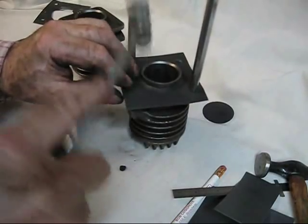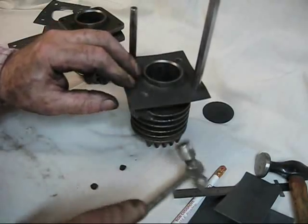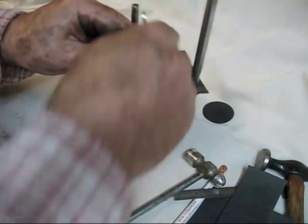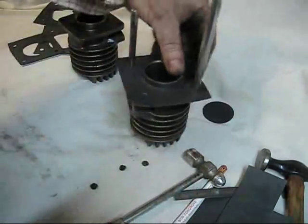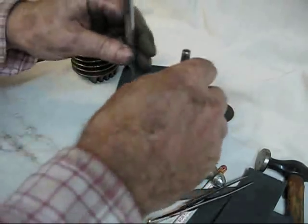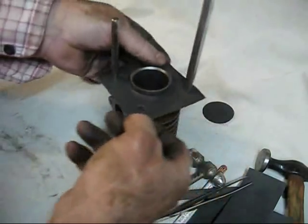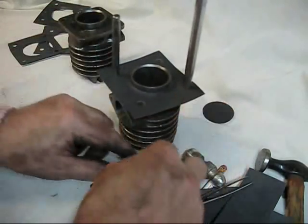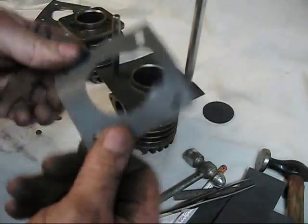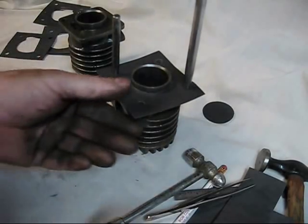All of these gaskets — the procedure for making them is the same. You just knock her out there, just cut her off. Now at this point most everyone would be tempted to go ahead and cut the outside edge away — just don't do that. Do not cut the outside edge. Cut them proud, and once you get it put together, then you can trim that away for a perfect fitting gasket.